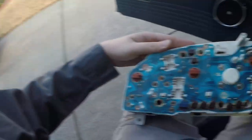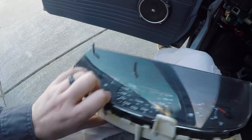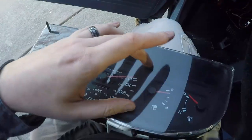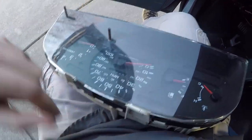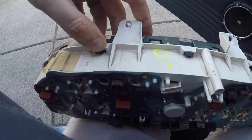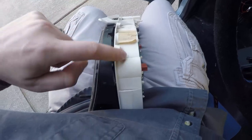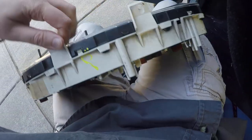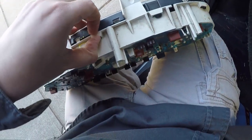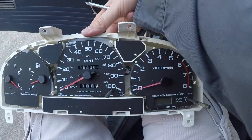Speedo on the left. I'll be pulling those screws out momentarily. Also need to pull off the plastic cover — kind of like a glass cover — and the inner bezel as well. To do that you basically push down the little tabs, and you can pull the clear plastic and the black bezel off as the same piece. Work your way around, push them down and out. That's what the inside looks like without the bezel — you can see a little blue LED in there.